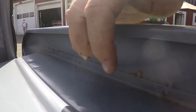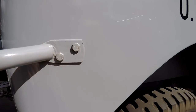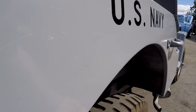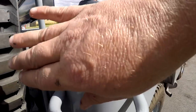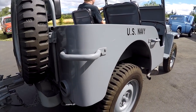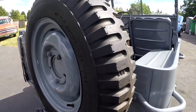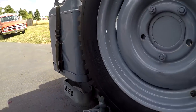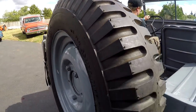This panel here was actually replaced. If you look inside here you can see the little stitch welds right there - it actually had a little damage in this area. These are single-walled, you can see from the other side. So instead of messing with Bondo and all that stuff, they just put a new panel here, which was actually a smart move and a lot less work.